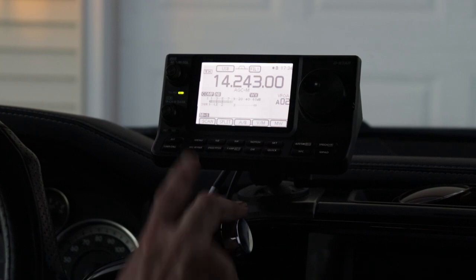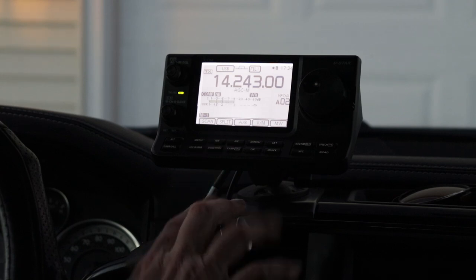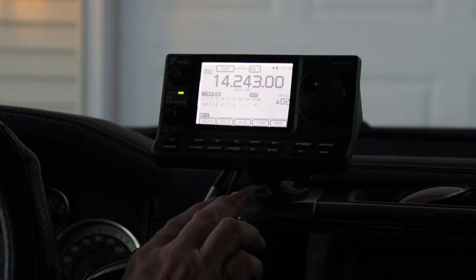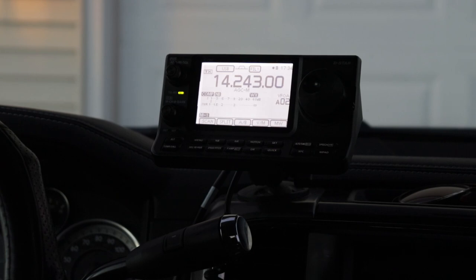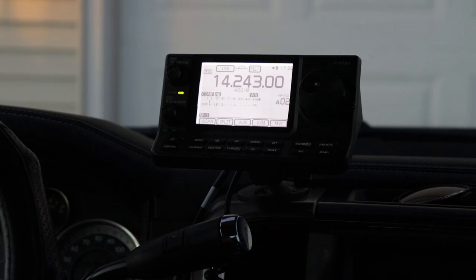You saw the alert tone and what happens on the display. Now the one feature — or rather lack of feature — that this radio does not have compared to a dedicated weather radio is SAME, which stands for Specific Area Message Encoding. That allows you on a dedicated weather radio to program your county and to program specific alerts you want to hear or don't want to hear — for example, only getting alerted for warnings and not for a watch or a winter weather advisory.